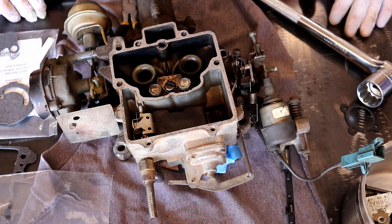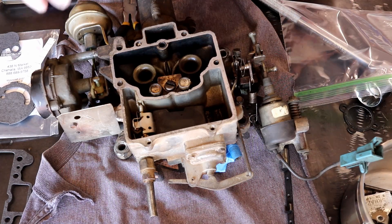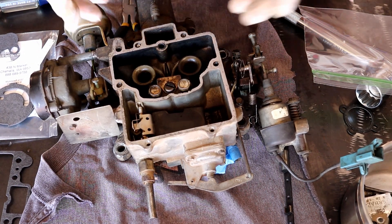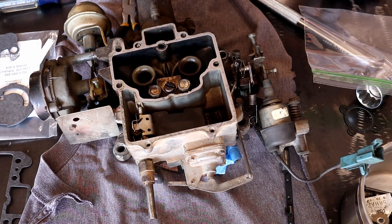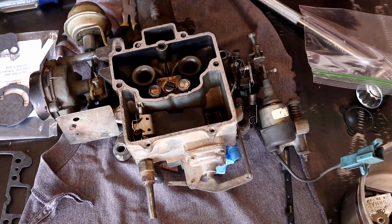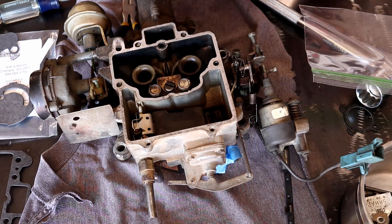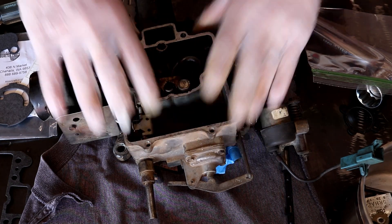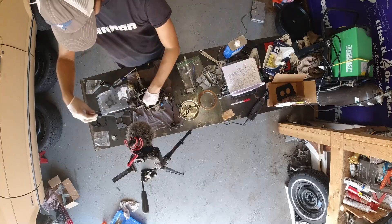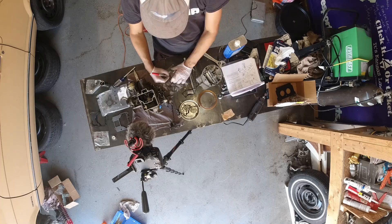I came into this a little unprepared, but I finally got a handle on things. Brought out some sandwich bags so I can put parts together as I disassemble. The goal here is just going to be disassembling the whole thing, because you want to wash everything disassembled. Then you go in reverse order of how you took it apart for reinstalling. Whatever the last thing to disassemble is gets soaking in solvent and washed first, then the carb body itself, and then you start reassembling. I'm probably just going to turn on the time lapse and let you guys watch from that angle while I get to disassembling.